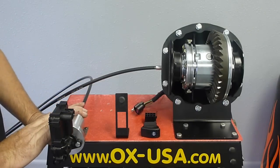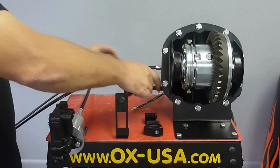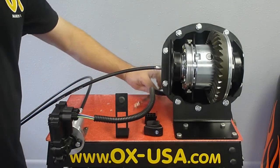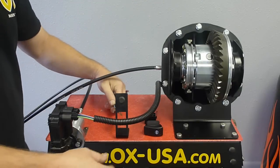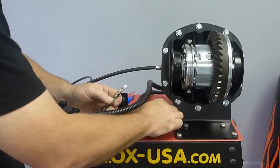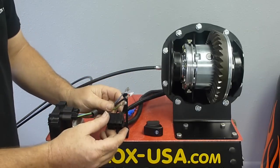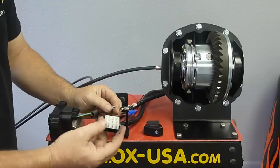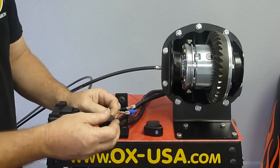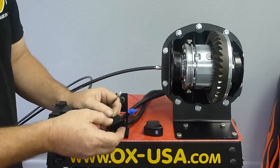This should now be properly adjusted. It's a matter of hooking up your electrical portion, which is straightforward — just plug the connector on. For the switch, after you've run the wire harness through the body and switch port to wherever you're mounting it on the dash, put the switch connector on the end per your instructions. The blue wire connects to pin seven, and the green wire connects to pin two, which is labeled on the switch connector.